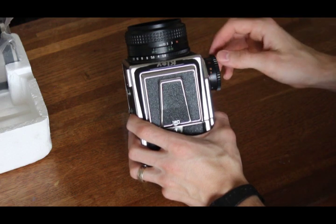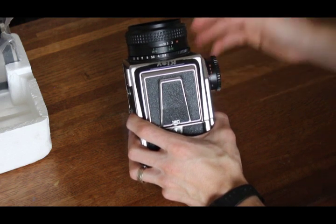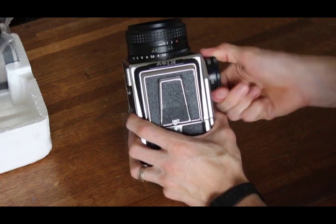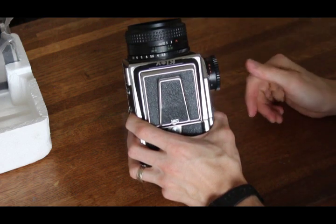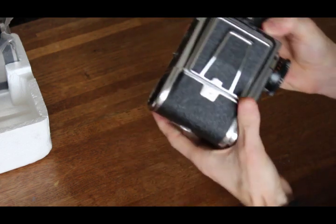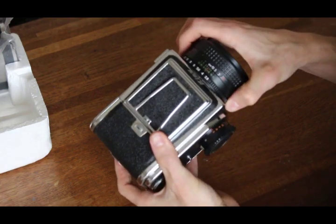One really important thing: you should never, ever adjust the shutter speed without cocking the shutter first again. You don't want to pull out on this knob and twist to a different shutter speed without cocking it first. So let's go ahead and cock the shutter — give it a nice good twist, basically a full circle. Make sure it goes all the way — it should click pretty audibly at the very end. Give it another couple of twists just to make sure it got all the way into place before you select another shutter speed. If you don't cock the shutter before you select a shutter speed, you could damage all the little gears and internal mechanisms inside the camera.